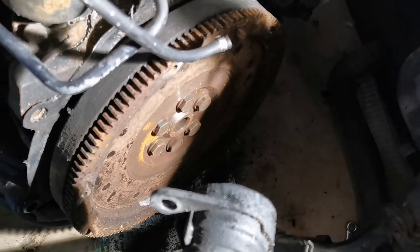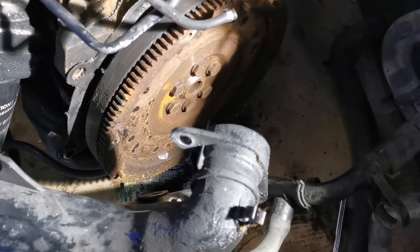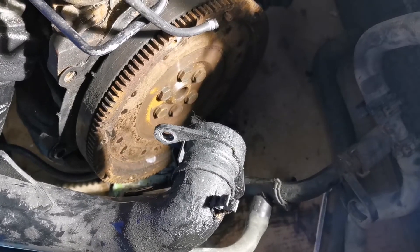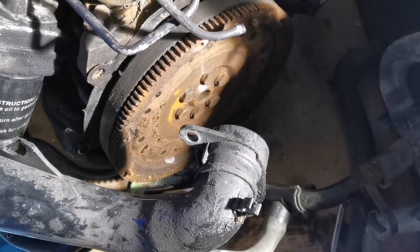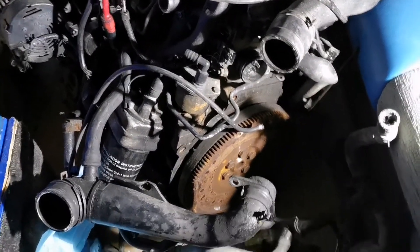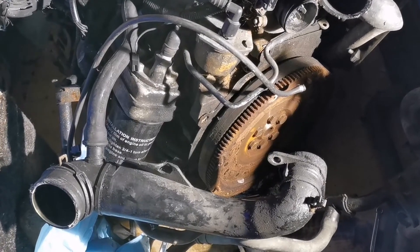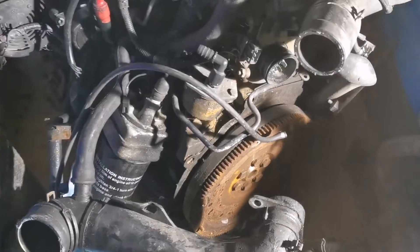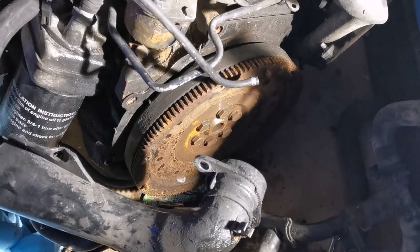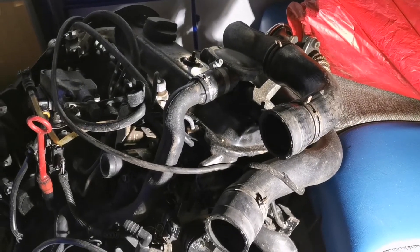This is a single-mass flywheel. A dual-mass flywheel basically means that you have two parts of the flywheel — one part is acting on the engine, the other part is acting on the gearbox, and there are damping springs between the two halves, and the clutch is in between those two halves. So it absorbs the vibration forces in the engine before they go into the gearbox, which basically means the engine doesn't act like an impact gun on the gearbox and shred it. These more modern TDI engines, the torque is a lot higher low down the RPM range. Anyway, I'll try and take the flywheel off too because that does need to come off — I'll try the impact gun and see how I get on, but I think I'll have to lock the flywheel and just use a breaker bar to crack them. Let's pivot the engine around and get at the turbo.